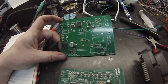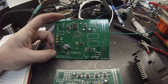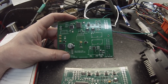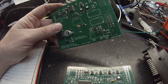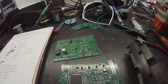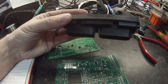The advantage is that this board is designed to mate with a Molex MX150 cinch enclosure, giving us a sealed box for all the VCU functions. We also have our revised CHAdeMO controller — I've made a lot of changes from the old JLD505 system. I'll make a video on that in the future, but this will be controlling the DC fast charging.